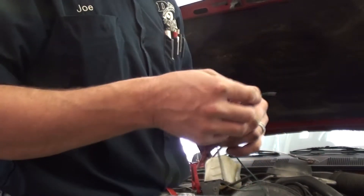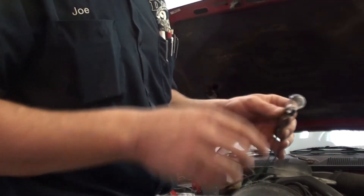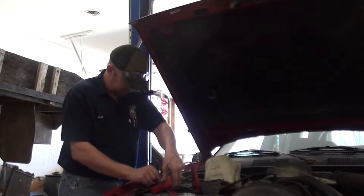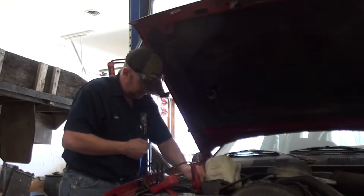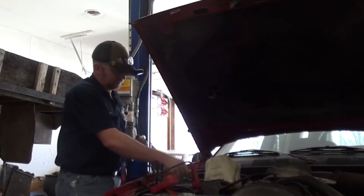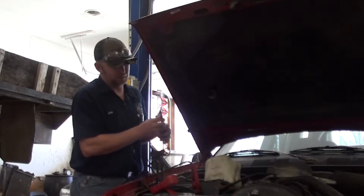Today I'm working on the computer trying to figure out why this thing isn't starting, and I think it's an issue with powers and grounds at the computer. This bulb pulls almost two amps — it takes two amps to light that light bulb. To light this LED test light takes only 0.02 amps. So you can see there's a major difference in power draw here.